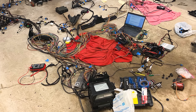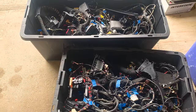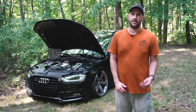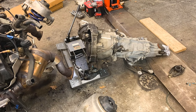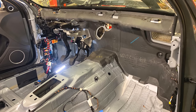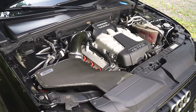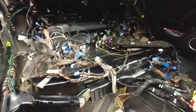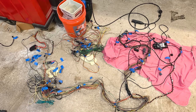I had to do a lot of adaptations and reprogramming the modules so they are aware that it is now in a wagon instead of a sedan. Most of the computers in there are S4, but there are some computers that use specific wagon stuff — like the tailgate controller for the power rear liftgate — that needed to be reused from the A4 and then coded and adapted using ODIS. It definitely took some time to figure out how to integrate everything to make it work as if it was factory. I took the entire body harness out of the sedan — that harness already had all the manual swap wiring in it. I traced connectors back to their origin or whatever module they plugged into, bought a de-pinning tool kit, de-pinned them out of each connector, and transplanted those pins into the S4 harness.